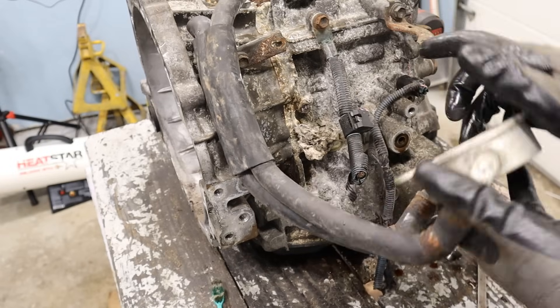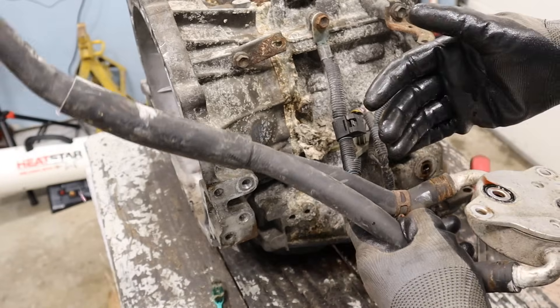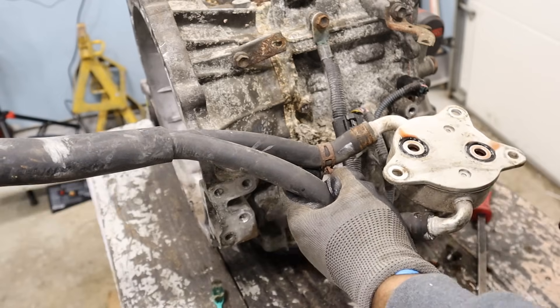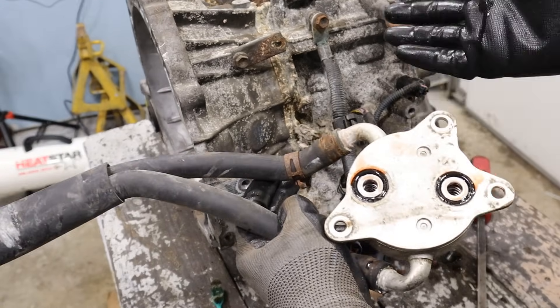Here's how the cooler works: we've got cooling in, cooling out, fluid in, fluid out. The fluid is nice and bright red — that's good. Essentially, the warmth from the coolant is going to be exchanged with the transmission's warmth, and they're going to warm up each other depending on who's warmer. Now in some cases this could be a failure point — mix them and you've got a milkshake inside your transmission.